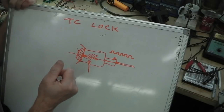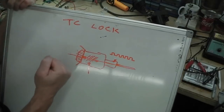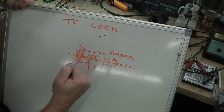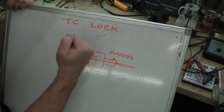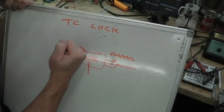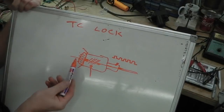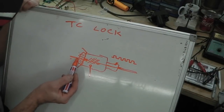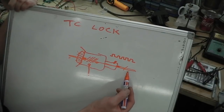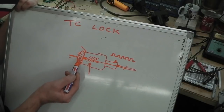Imagine sticking a spoon in some ice cream that's just beginning to melt. It's all slushy. As you spin that spoon round, you start to drag the tub round with it. But if you were to grab hold of the tub, you'd still be able to be continuing to stir your spoon round in the tub. Well, that idea, that effect of viscosity. I know it's a crude explanation, but my engine output here can spin round freely with this locked, with the wheel stationary, the car brakes on, and it doesn't stall the engine because it slushes round in that fluid.